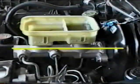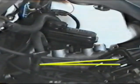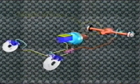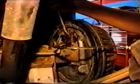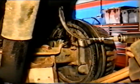If the master cylinder cannot be positioned in this manner, get it to at least a point where the body is level. If this cannot be accomplished, then combine RFI with pressure or vacuum bleeding to get the best results. Once the master cylinder has been positioned, then begin the bleeding process at the first wheel in the bleeding sequence. Connect the output end of the tool to the bleeder and the input end to the fluid supply container, making sure it is full. With the tool connected, open the bleeder screw and then slowly stroke the handle.